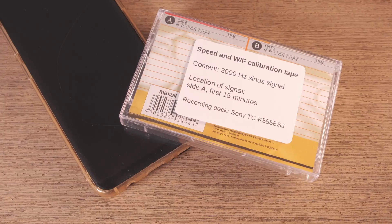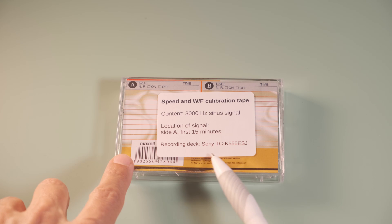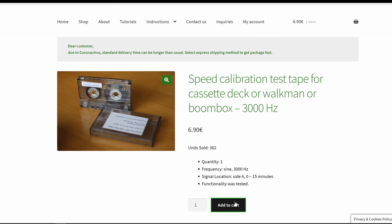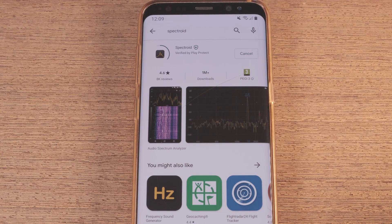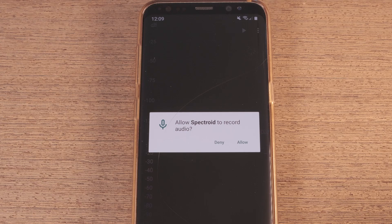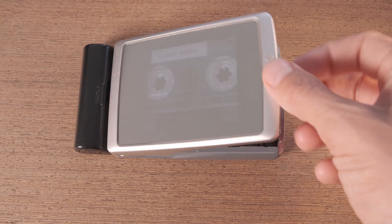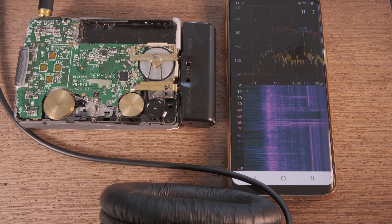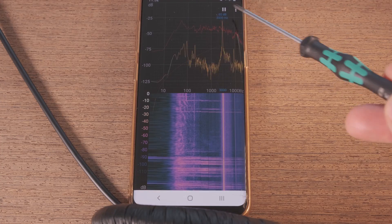Method 2 is also really easy but way more accurate. We will need a smartphone and a speed calibration test tape. A speed calibration tape has a 3000Hz sine signal recorded on a well-maintained quartz control cassette deck. I got mine for 6 euros and 90 cents on FixYourAudio.com — link in the description. They also have an eShop on eBay under the name MIHOKM with 12,000 sales and 0 negative reviews. Download an app on your phone capable of measuring frequencies — on Android I use Spectroid, and for iOS Audio Spectrum Analyzer works great. Play the speed calibration tape out loud, or place headphones next to the phone microphone, and check the readings on your app. Tweak the screw on your cassette player till it reads 3000Hz. If you're fixing a Walkman, you won't be able to set it exactly to 3000 due to wow and flutter, but 3000 plus or minus 30 should be fine.